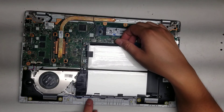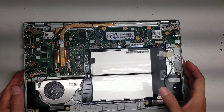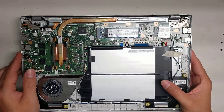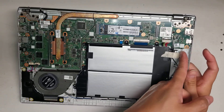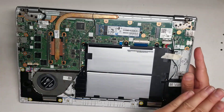And the battery — if you take it out, just know that there's these little notches that have to go underneath this plastic here. So hopefully this video helped you. If it did, please like and subscribe. One other thing I didn't mention: if you need to change the keyboard, they do melt these plastic things in place on top of the keyboard, so your best bet would actually be to replace the whole palm rest.